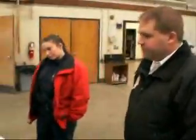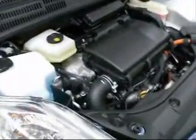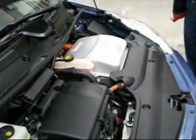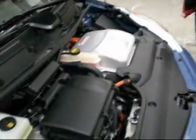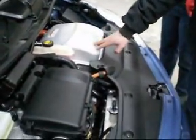To explain a little bit about the hybrid concept — hybrid, by definition, is when you bring two things together and make something new. We have a gasoline combustion engine, similar to what you'd have in your car, but we also have an electric motor here. This car runs a parallel system, so it can run on just the gas, just the electric, or both at the same time. Some run in series, and this car can go either or — so you can have a completely silent vehicle when you're running.